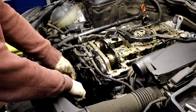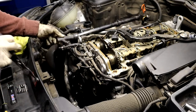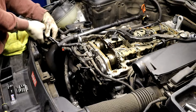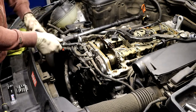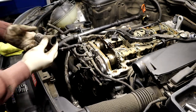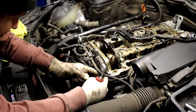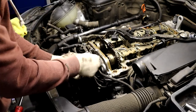Pull the coolant line coming off of the thermostat, not the clipped on one. There's another one with a clamp on it. Bottom area, get that one off. Got another one to the shut off valve. Valve and the thermostat. Okie doke. And you got a couple terminals here for the ground. This out of the way. This one for the solenoid. Just squeeze this stupid spring clamp.